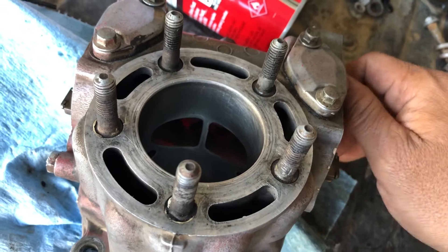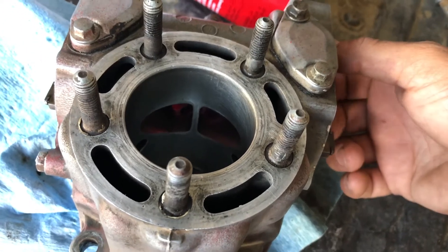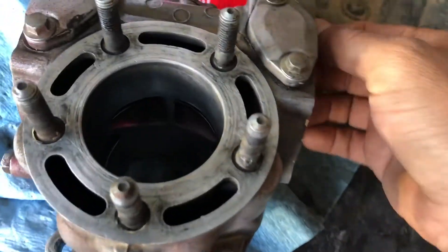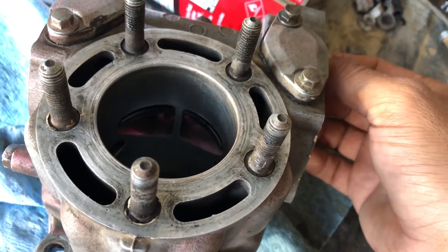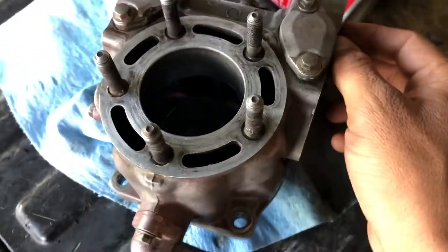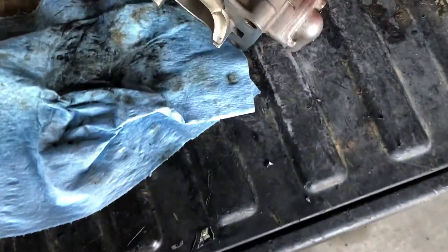As RPM picks up, these valves get pulled out — this rod gets pulled down and the valves are no longer visible. That happens at three thousand or more RPM. So if you look at your cylinder and those valves are not showing but this rod is in the up position, not down but up, then you know you've got something wrong.